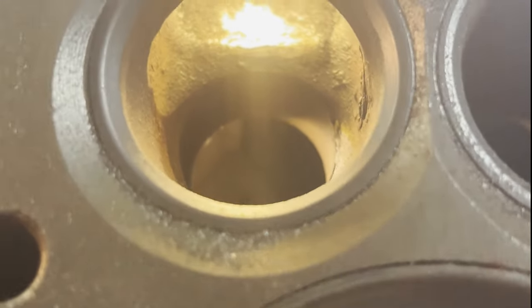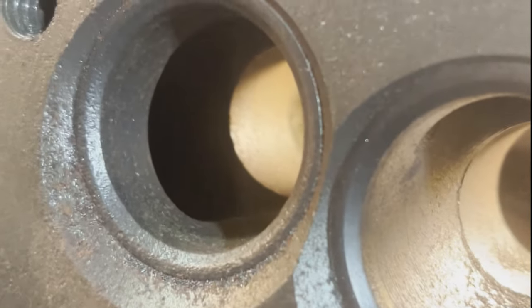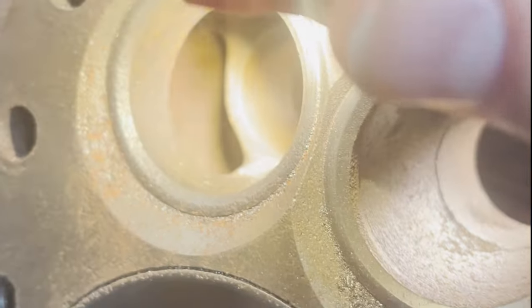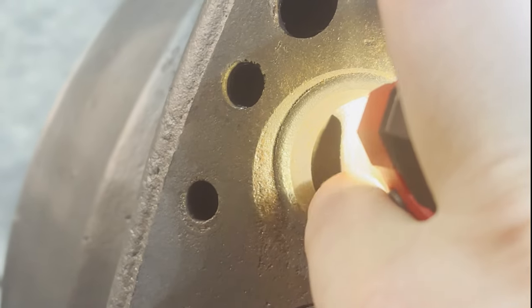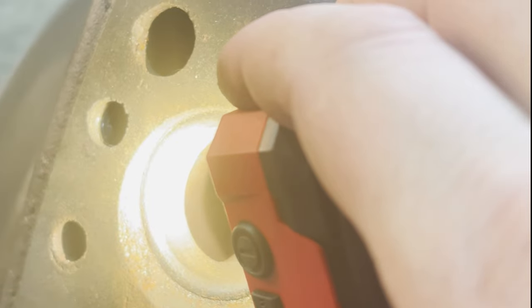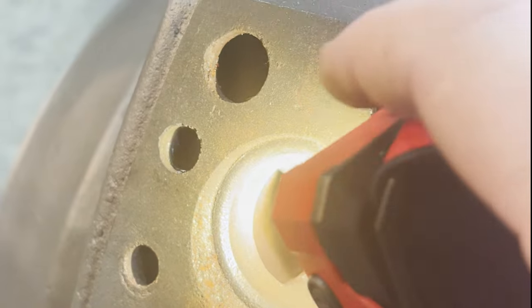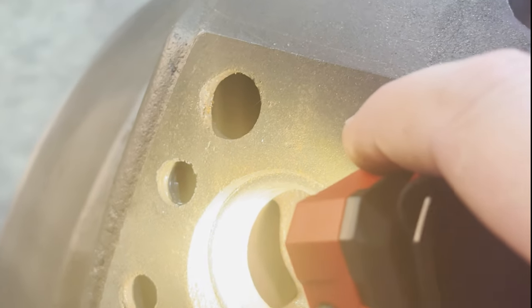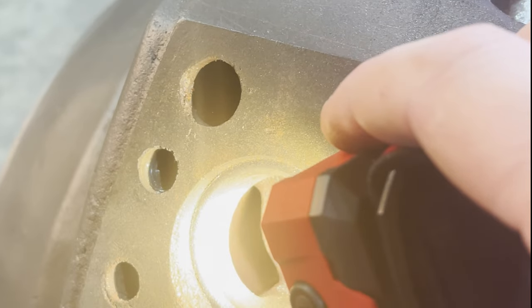And then on this side as well, we're going to be working the outlet manifolds, and we'll be getting to that eventually. A lot of this lip right here is going to be cleared out because there's a lot of extra material that's making it difficult for the exhaust gases to get out. We'll get more into that when we get to the exhaust, but for now, we're going to be doing a nice time lapse of doing some intake runners.